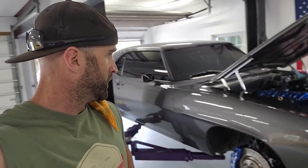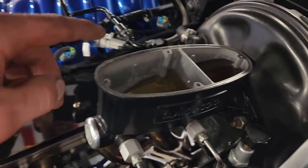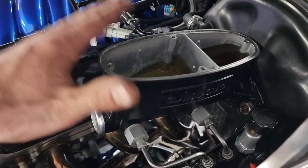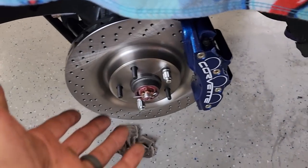Well, that was the shortest montage ever. We are dead in the water, boys. Dead in the water. So my Motive brake bleeder has failed me. I'm always saying you guys should have one of these. I still do, link in the description, but this car has got a Wilwood master cylinder. So Motive makes this plate that basically goes over the top of that to pressurize the system. And unfortunately, after topping off the fluid, I realized the plate is not big enough to cover this. And obviously if it's not big enough to cover this, we're not gonna be able to pressurize the system and therefore we won't be able to bleed the brakes.